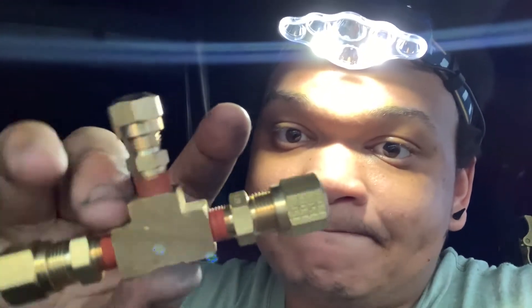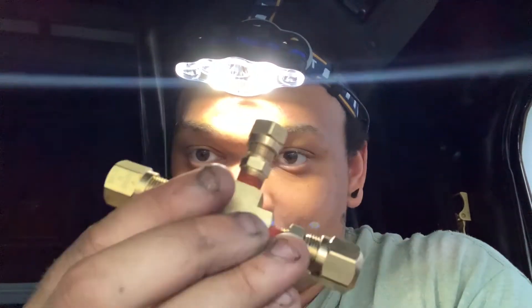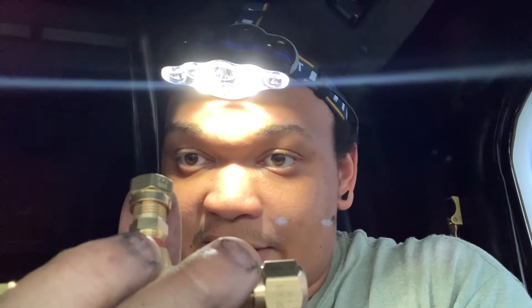There's really no part number for this — I went to Fleet Pride and the lady put it together for me. It's 3/8" to 3/8" and then quarter inch for this black airline. All I'm gonna do is split the airline down the middle, connect one in, connect one in, and T off for the gauge.